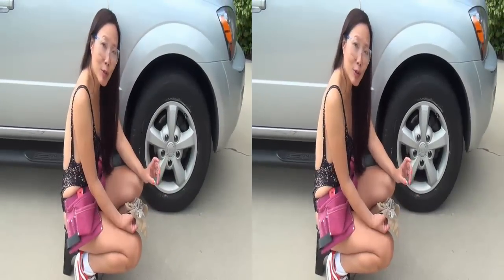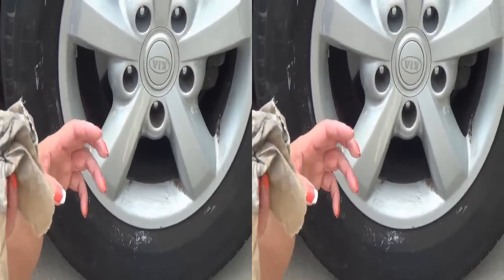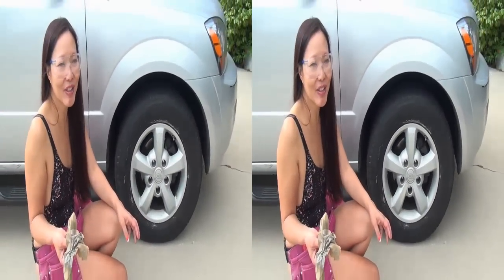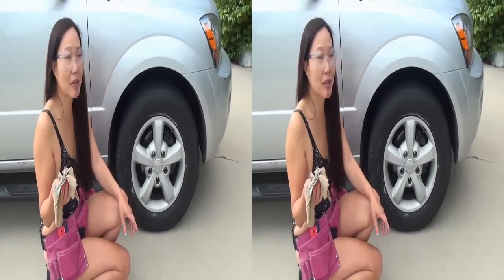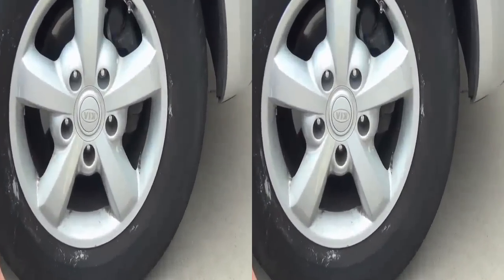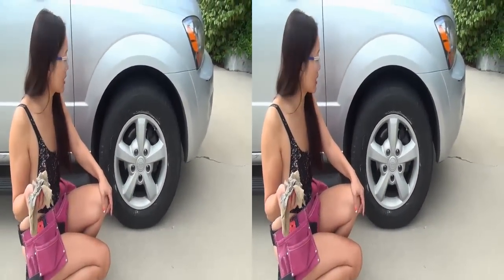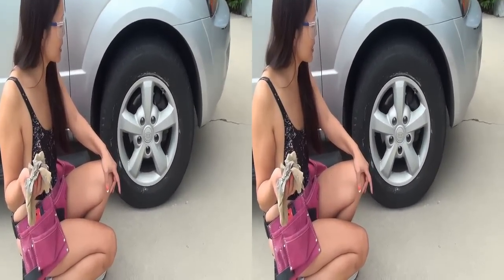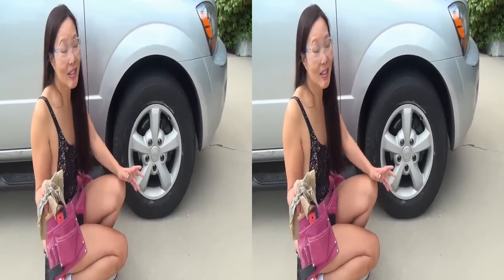One of the things we told you is that you don't use this if you have a painted wheel or a clear coated wheel. So one of the things they say is when you wipe it, if it comes out black it is not clear coated, or if it is clear coated where the clear coat has worn off it does turn black. Now we already know that this is a clear coated wheel. We've decided that we could just work on the damaged areas but we decided to go ahead and clean up the entire wheel just to make it look better.